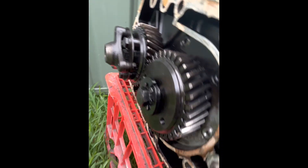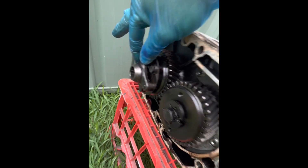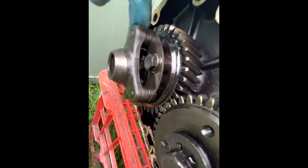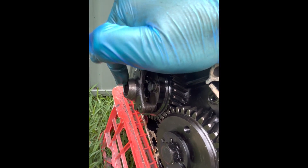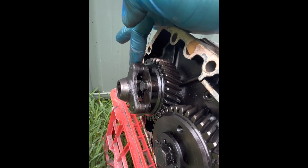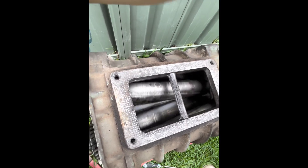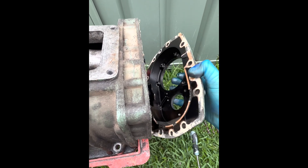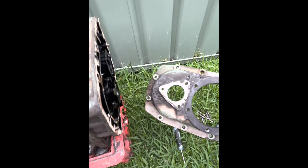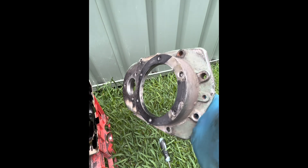There's the original front gear set — it turns real nice. Here's the drive coupler. You wouldn't use this one when you convert a blower over; you'd use a different spline diameter and a stronger one than this three-bolt pattern. A spline shaft behind your pulley snout drives that coupler — that's real good. That's the end cover you want to keep: it has that platform there to bolt on your drive snout.